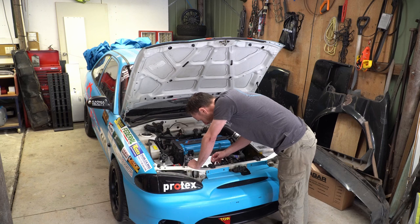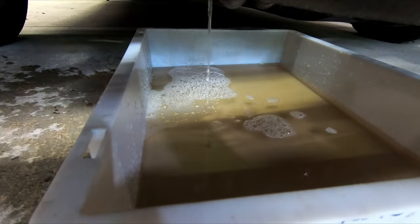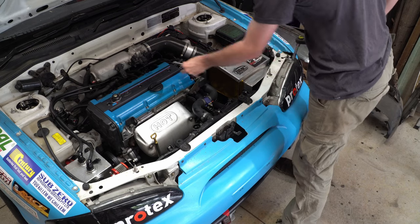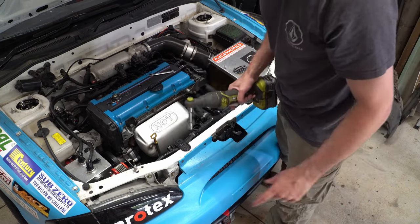There is a tap on the stock radiator. That is very tight. You can just pop your bottom hose off, but I'm going to try and control how much water is coming out at once. We saved the majority of it. While that's draining, we'll pop off these top brackets — it's just two 10 mils here. We'll use our Ryobi whizzer.